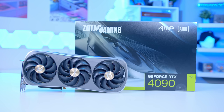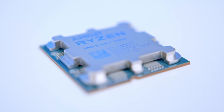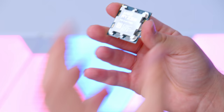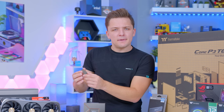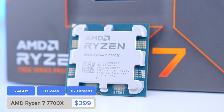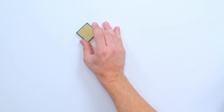Of course, we do need to pair it up with a good CPU. This is the AMD Ryzen 7 7700X. You'll notice it's got quite a cool design with a raised IHS, which can cause some challenges for coolers, so make sure yours is officially compatible. Plenty of cores, plenty of threads. The main thing is the class-leading single-thread performance. The 4090 is so powerful, you need a very quick clocked CPU. That doesn't mean you can only go for a Ryzen 9 — just whatever you get needs a decent core count and relatively high clock speeds.